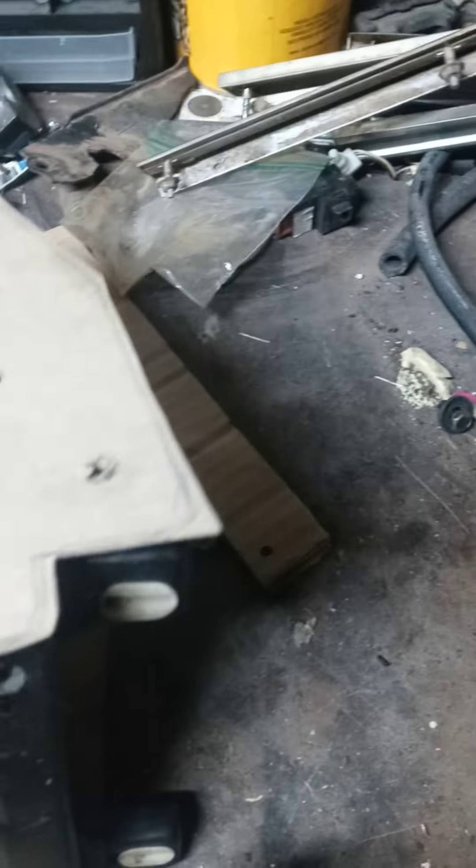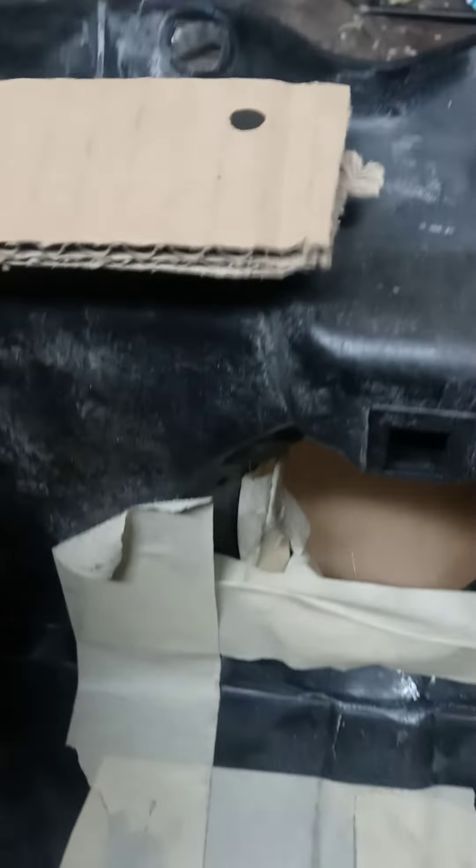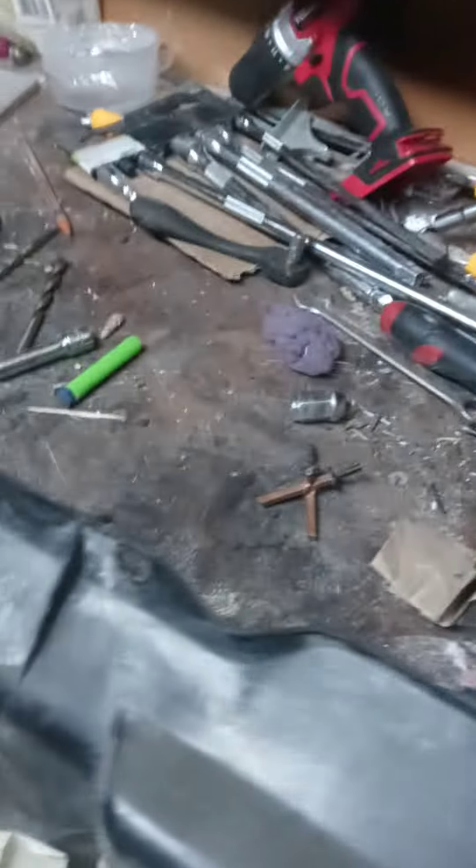How I'm going to drill my holes - I traced this out and this works for both sides. This is for the passenger side; I flip it over and it works for the driver side. How I'm doing the holes - I went out to the car and took this piece of cardboard with me and marked where the holes are at on the core support, and then I'm pretty much lining it up and I'm going to drill the hole like that.